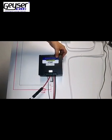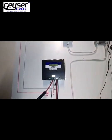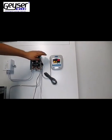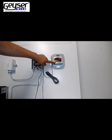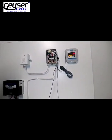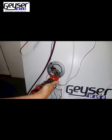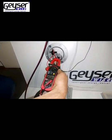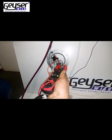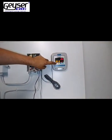The green light is flashing again, which means the DC side is working perfectly and the element is drawing power. To test the AC element, simply press the power button on the display. You will notice 3 red water drops come on the display. Then take your AC clamp meter and clamp the AC wire — you will notice that the element is drawing power, confirming the AC element is connected correctly. You can then switch off the electric element by pressing the power button.